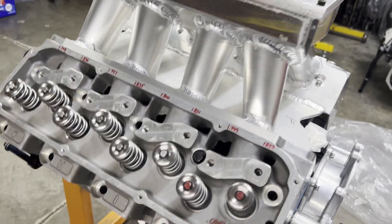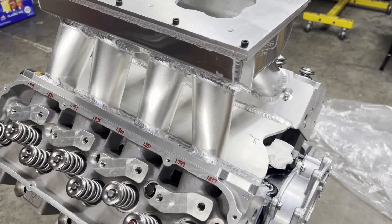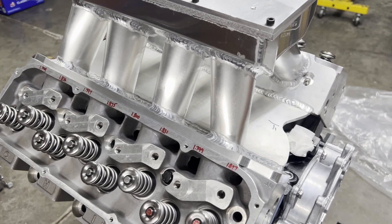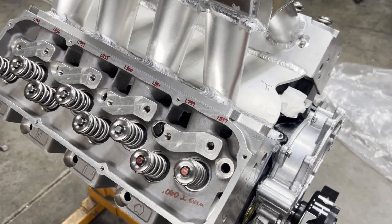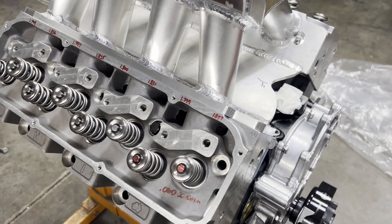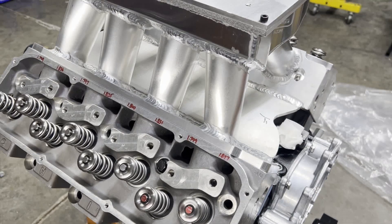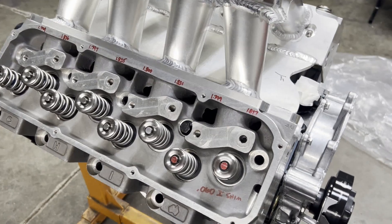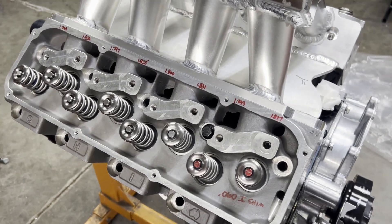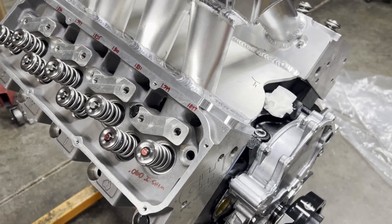We are back where we started - oil pan is back on. FedEx dropped off my gasket and I got that put on. We did check the rod side clearance: 21-22 thousandths. Everything is back on the engine waiting to be bagged up. I've already sent an email to order those pushrods, and I want to drop off our TND mounting bars to have those machined. Making progress - just waiting on head gaskets and a few other parts and we should be ready to rock and roll. Thanks for tuning in for this episode. Hope the geometry and pushrod length check helps you in your own build at home. Hit that subscribe button - talk to you guys later, see you next week.